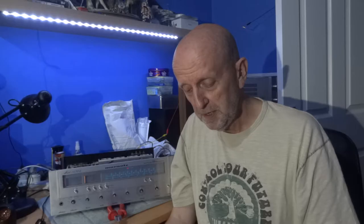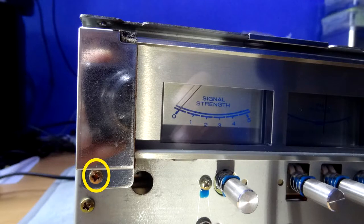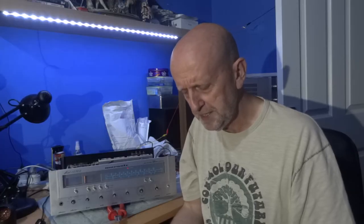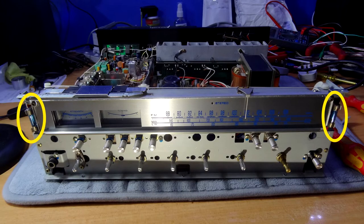The front will just come off like this. As you can see, the left-hand side housing — one of the bulbs' front covers — needs to come off, so we undo this screw here, lift it up a little bit, and it just unclips off. We do the same on the right-hand side of the unit — take that housing off with that one screw under the housing. So here we can see the two bulbs that need replacing, but like I say we've still got two more that need to be replaced as well, so we'll leave them for now.